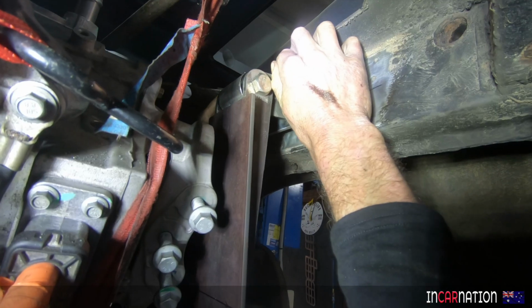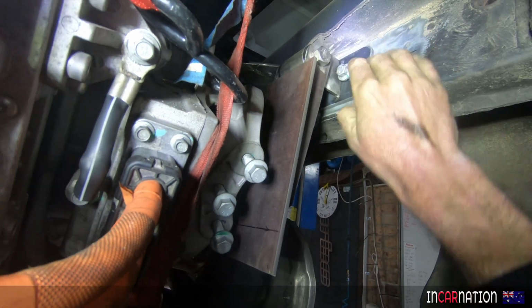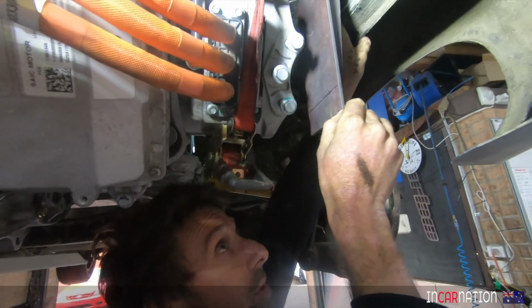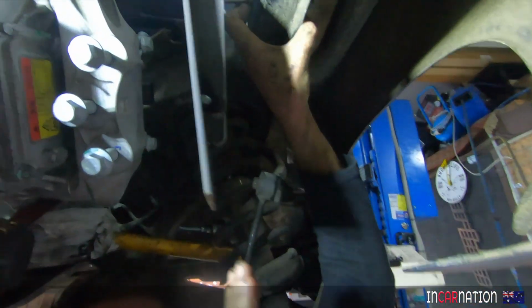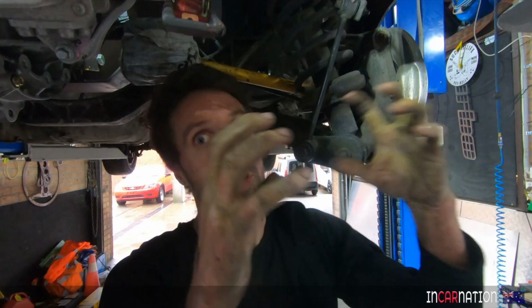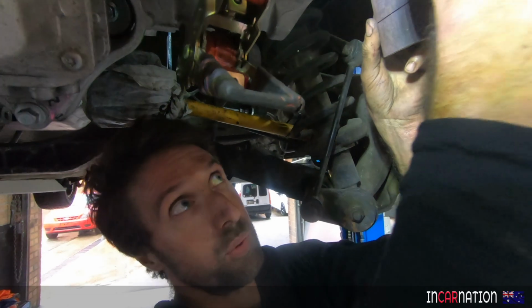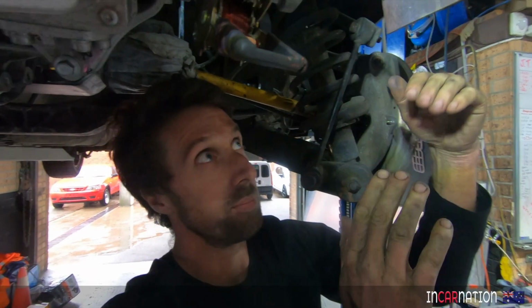Tack that on. Yeah, perfect. Build the plate off there, and yeah, it'll be good to go. The gusset just perfect, like 90 degrees to it, so it sort of ties back to where this is. Yep. So at no point is it like a butter knife. I know it's 5 mil thick, but it's flexy. As soon as we box it in, it's got structure, so even if it's not going to tie to that, it'll weld to there, which on the other side is the gusset. So that's why I put these long, because you'd be surprised. You can flex that steel quite easily. Really?